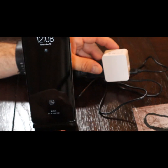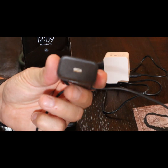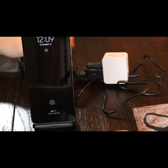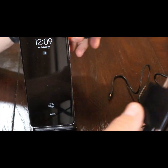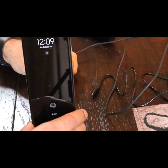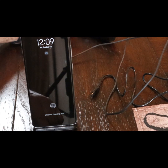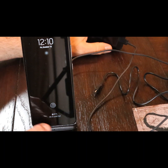Is the problem that I'm not supplying it with enough power? I'll try a USB-C fast charger that can go 12 volts at 5 amps, whereas the charger calls for 12 volts at 3 amps — so it should have enough power for a wireless fast charge. I plug that in... wireless charging at 81%, 35 minutes until full. So it did speed up, though it still doesn't say 'fast charging' — but that's still twice as fast.